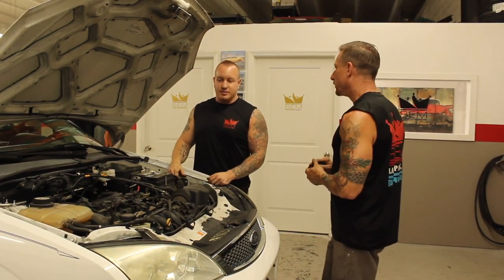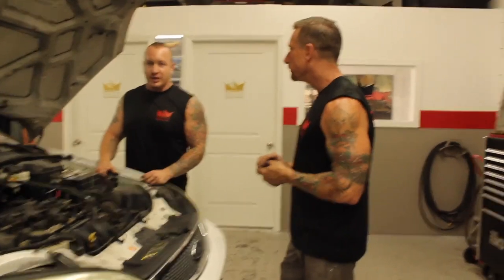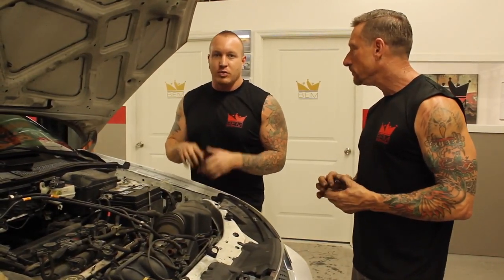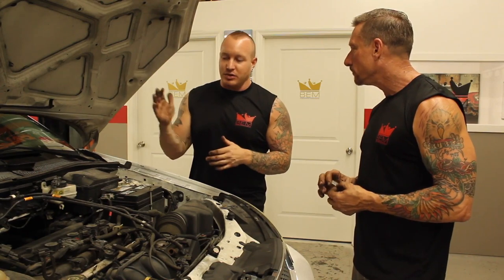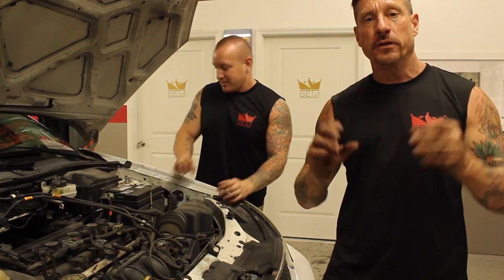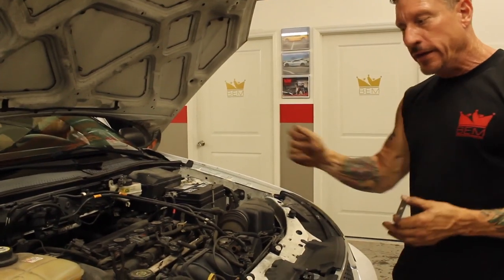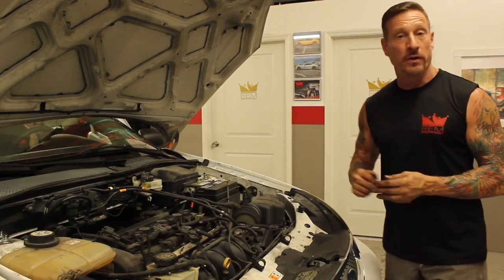How do you do that procedure? It takes two people typically, unless you have a suction tool. So we're going to do a manual bleed on this thing — it's actually going to be a two-person system. We're going to be inside the car pumping the pedal and holding it down to the floor while the other opens the bleeder after that pressure fills up under the pedal. As they open that bleeder, it will allow the pedal to drop down and push through all the pressure. Very important in a two-person system: once somebody says pump it up, you repeat their command. Then hold it down — repeat their command — holding. Then they know when to open and close that bleeder, which does not allow air back into the line prematurely, just having to start all over again.